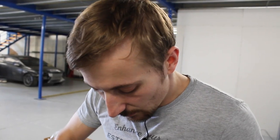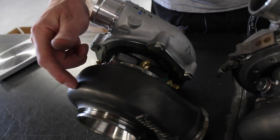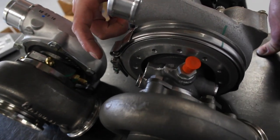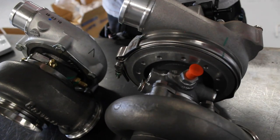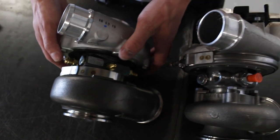One feature that's quite interesting: the G-Series has a v-band connecting the core to the turbine housing, while the EFR has a v-band connecting the core to the compressor cover. The v-band is really nice in terms of how easy it is to adjust — just one nut, self-tensioning, they don't really come loose. It's interesting that they've done it on different sides, because it would be really nice if they had v-band both sides like on a full motorsport turbo.